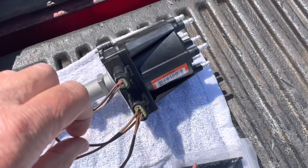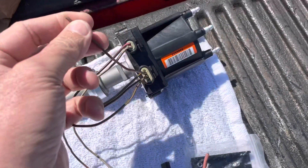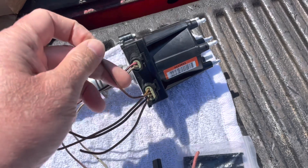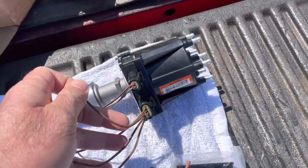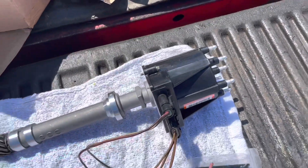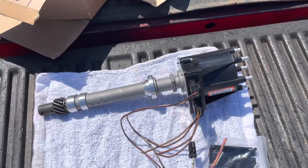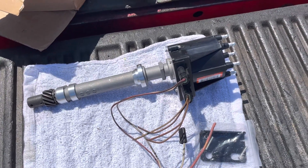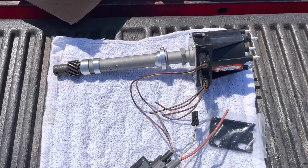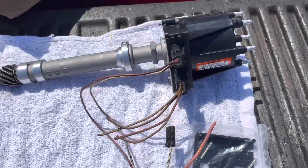Connect that alligator clip to 12 volts. The first two wires will be looped together and it will now be in base timing mode. I've done a previous video on how the GM fuel injection timing tool works and I'll put a link in the description. When you hook up 12 volts to this third wire, you make the distributor be in base timing mode, then you set your timing with a timing light. Once you are done, take this loose.